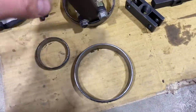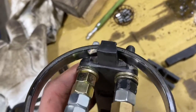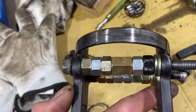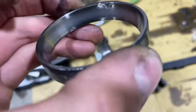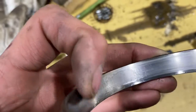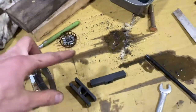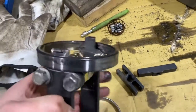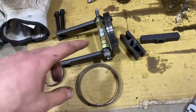I'm slowly working away at getting these races out. I went to Princess Auto and picked up a puller, then modified it — had to make it smaller so I could fit it in the notch under the race and space it out depending on which size race I was doing. I have a hook on the slide hammer that just barely fits, and with enough force it does come out. Here's the input shaft race — there's some good pitting there. Real nice pitting on that one as well, same with the rollers out of the input bearing. Lots of carnage. I have three out so far.